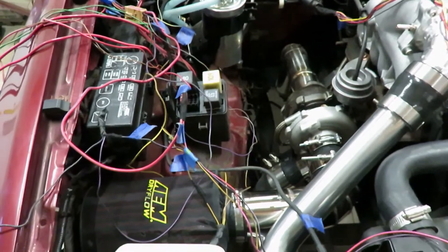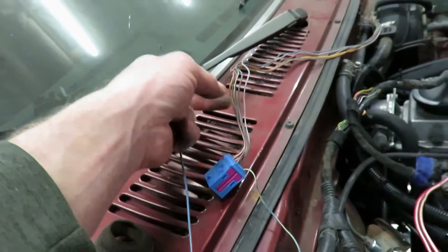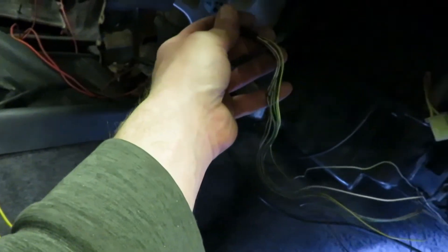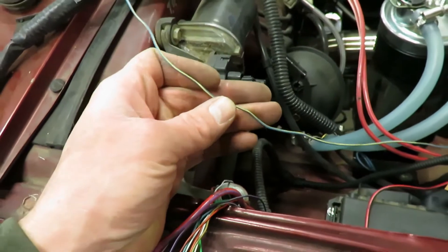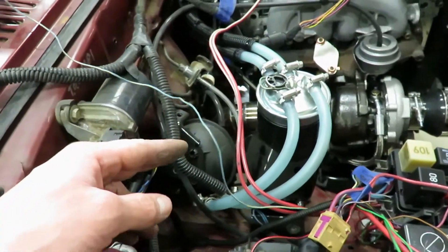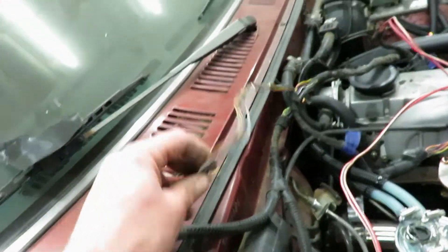As far as this throttle goes, a lot of people are having to lengthen all the wires for them to reach, but I found an easier way. I pulled this blue connector and it runs about halfway over through the dash already. So all I really need to do is cut this one power wire and lengthen just that wire — all the rest will be under the dash — and I'll have one power wire coming up to the relay. I'm going to snip this, add more length, and get it all wrapped up and under the dash.